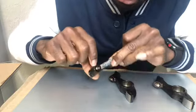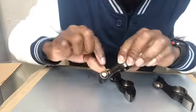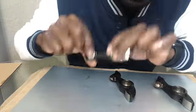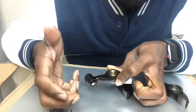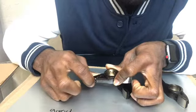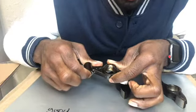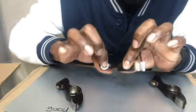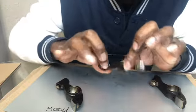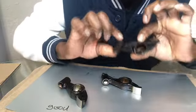With a good lifter, you can see where the plunger goes into the cylinder — it creates pressure and moves very easily. There's no holdback. It has tension because there's a spring inside, but it bounces right back, very easy, no problem. That's how you know if you have a good lifter. If it's like the stiff one where you had to really push and feel resistance and it's not smooth, replace it. If it's completely dead like the first one, replace it right away.